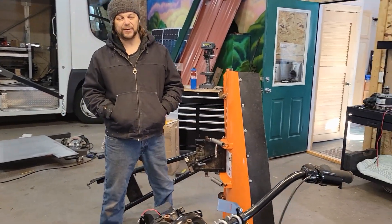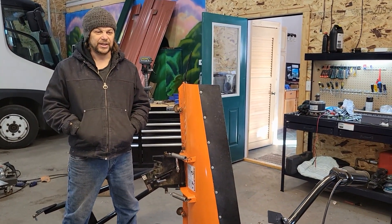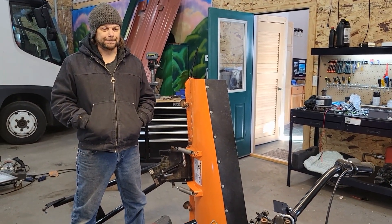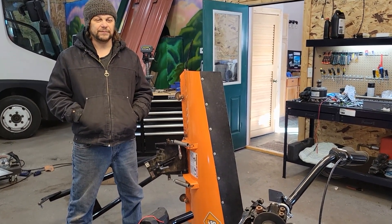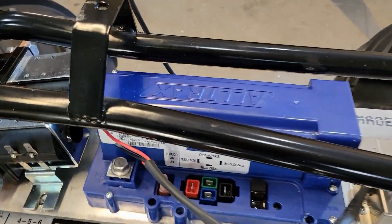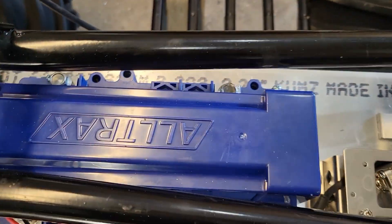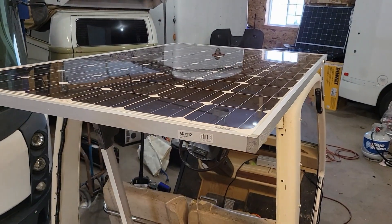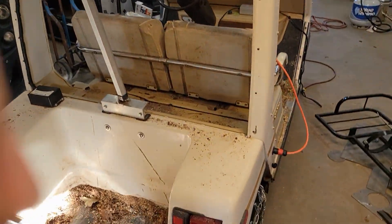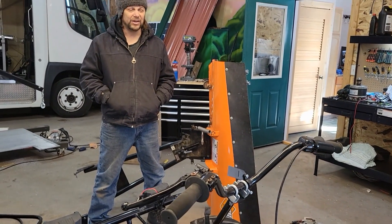Today I just got the battery fastened down — that's about a nine kilowatt battery. We also have a 72-volt, 500-amp Altrax controller on there. I just absolutely love these Altrax controllers. I've used them in everything, including our golf cart that my friend Scott Berman and I have been beating on for years, and the thing just keeps coming back for more. We can't kill it.